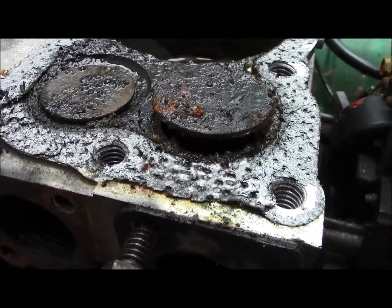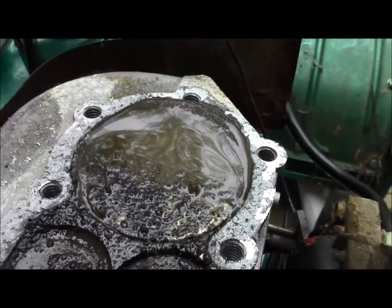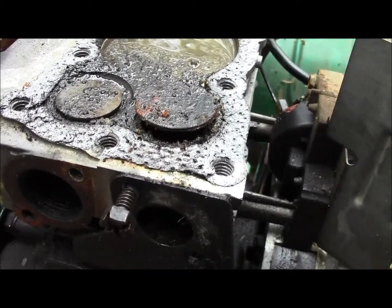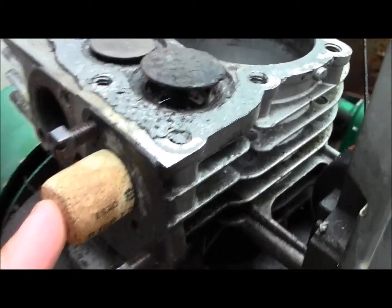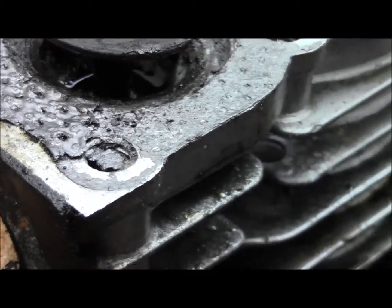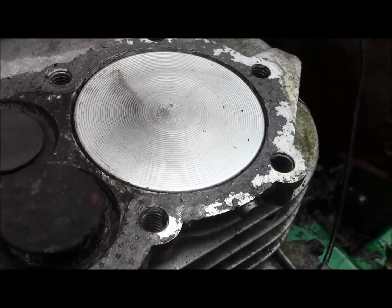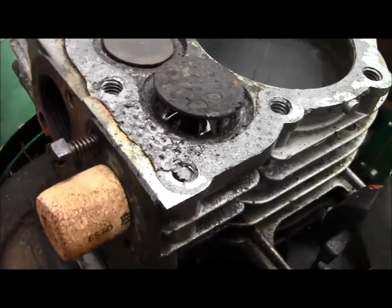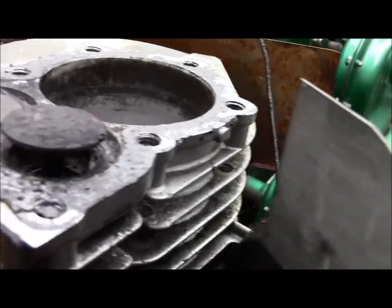As you can see, it's not looking good. I pulled the head off — there's the intake and there's the piston. We're going to do some cleaning up here. I sprayed some WD-40 around to try to get the valve freed up. I put the cork back in the carb intake and soaked it with WD-40, cleaned up the inside of the engine. There's still some debris there so I've got to be careful. I might have to do some persuading — give it a tap on top — and see if that will work.